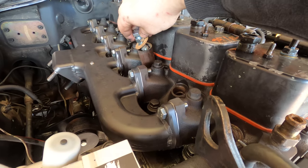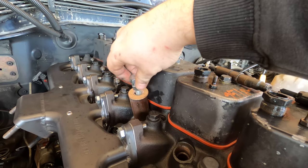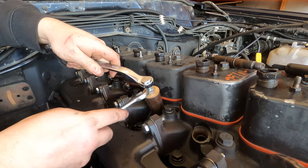The tool is essentially just a length of pipe with a nut welded to a bolt, and another nut used to pull against a washer against the pipe and lift the injector out of the head. It's just a simple puller really.